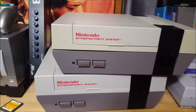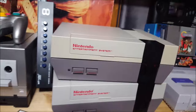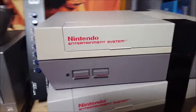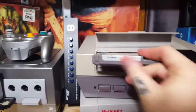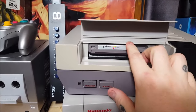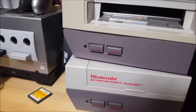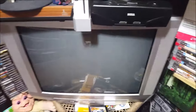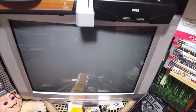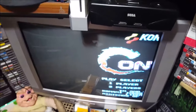All right, as you can see, I'm in my game room — this is where I test my NES. It's actually separated here because I already took the six screws out. If you don't know how to take out the six beginning screws, you don't need to be doing this. Here's my copy of Contra. We're going to throw it in. These are the original pins in here, so it goes in very, very easily — too easy. That's when you know you're dealing with the original pins. If you pick up an NES and it's super tight, chances are you've got the brand new ones and they're going to suck. We hit the power button and as you can see on the TV, we're getting a blurred image. It's blinking because I need to disable the lockout chip.